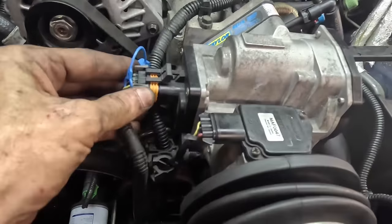You know what else is cool about doing this? If something is not right, like a spark plug wire has a hole in it or is leaking spark, the water will actually reveal that. For example, let's say I spray those hoses and it starts misfiring. I go, hey, those hoses don't like water very much, something's wrong, and then I can take another look. Ooh, look at that. Oil's starting to bubble out.